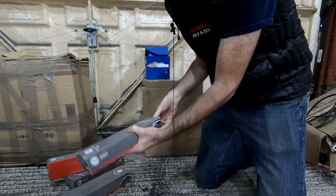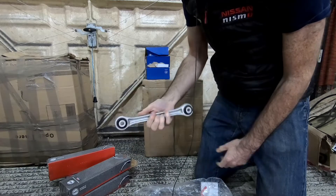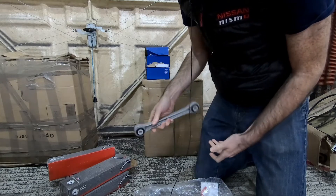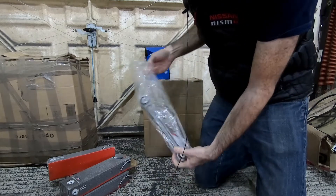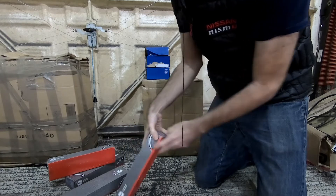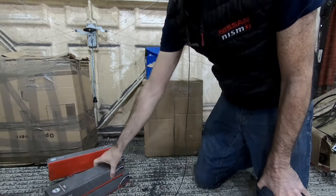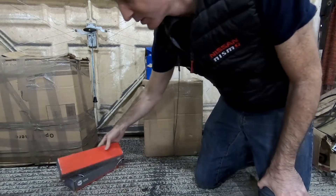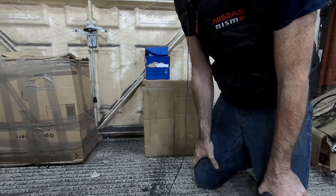So I've got all the rest of the components as well. Here we've got our upper control arms, also known as dog bones for obvious reasons. These are not OE, but they are a pretty decent manufacturer — I haven't read anything too bad about them and they come with a two year warranty. The Porsche suspension design is a modern sports car so it's not a simple piece. We've got two upper control arms on the rear on each side — that's four of those. And then you've got a total of three different types of arms for the lower.